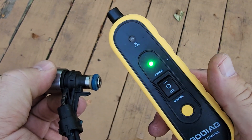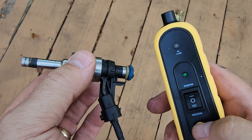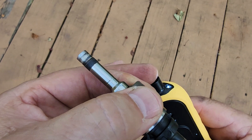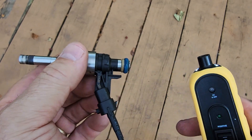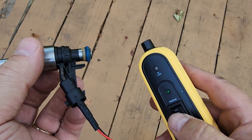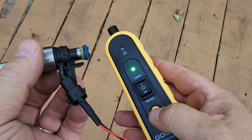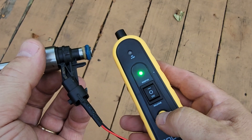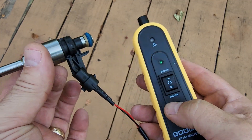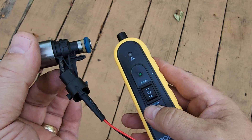I do like this little circuit tester. It can test relays, it can test fuel injectors, and it can also inject voltage — you can put that onto your fuses and wires. So it can inject power voltages, read voltages, and apply pulsing stimulus. It can do a number of things. I bought it for working with the fuel injector, and because it had so many other functions, I thought this was the best one to pick up.